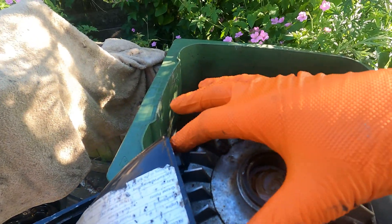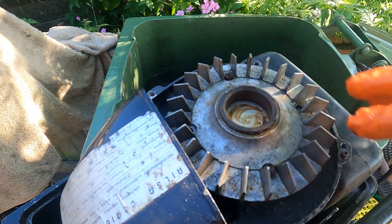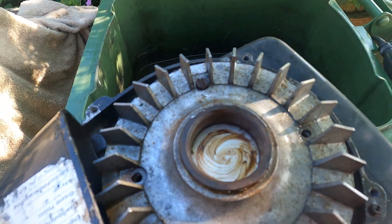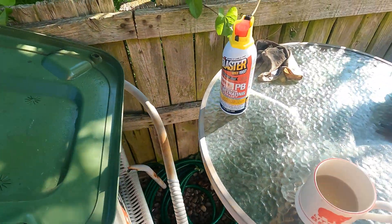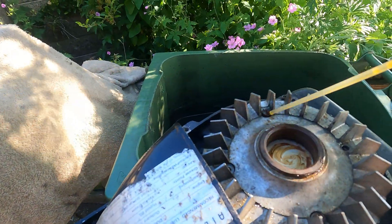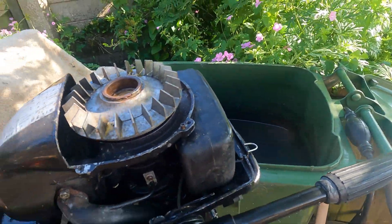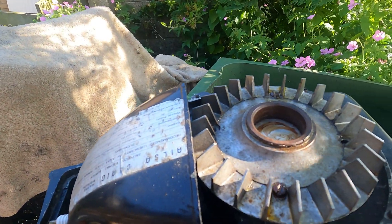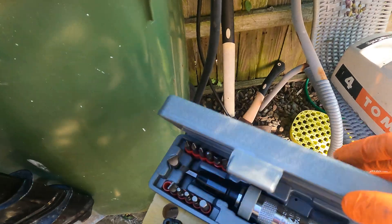Now we've got that off. Because it's air cooled, this is the fan - it looks like the flywheel but it's not. The flywheel is beneath this. I've already taken two of these flat screw heads out. A good tip for these ones: soak them in a bit of penetrating oil - I use PB Blaster. Just a light squirt on there and let that soak in. Now if you are struggling to remove these because they are quite soft, especially on an old engine that's never been out for a long time, I recommend getting an impact driver.